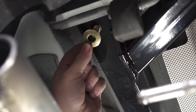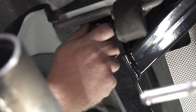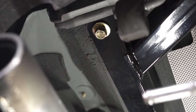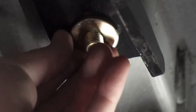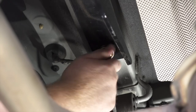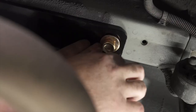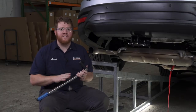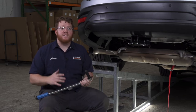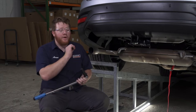Now we're going to remove all of our fish wires and install our provided conical tooth washer with the teeth facing up, along with our nut. We'll repeat on the other three. Then we're going to tighten and torque all of our bolts to the manufacturer specification — you can find those specs in the description below. We'll be using a three-quarter socket on all of our nuts.